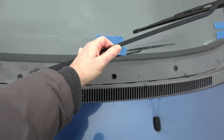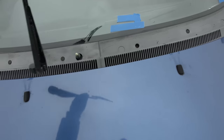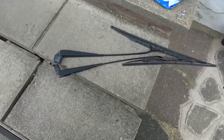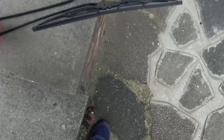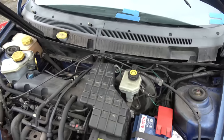With the nuts undone, if you close the bonnet and then just lift the wipers like that, you'll see they come off nice and easy. Remember we've marked them up so there's no problem putting them back, but remember they are handed - left and right - so make sure you put them back in the correct order. That's the right-hand one done. Now, just because it's getting in the way, let's take this rubber strip off.